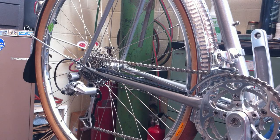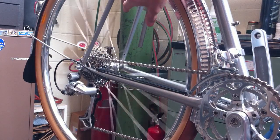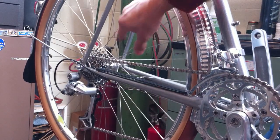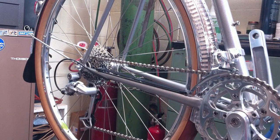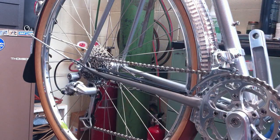That's the Boxer Bicycle Custom Integrated Chain Rest. It is an option available on all Boxer Bicycles. It requires some slightly specialized equipment, but it's all Shimano standard equipment, or you can do it with a freewheel system that doesn't use a cassette. It just requires a little extra space on the end of the axle for the chain rest.